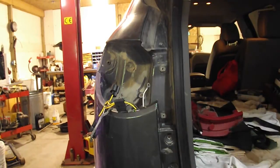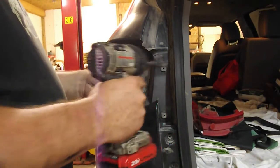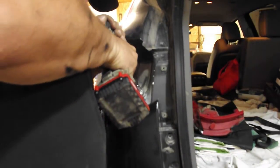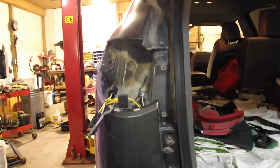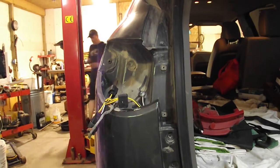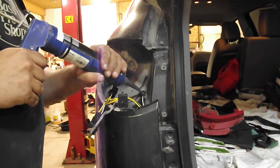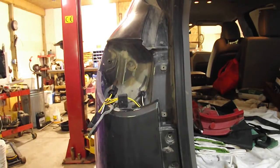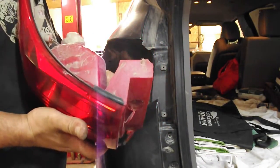To finish up this installation, we're going to create the ground. I ground off a little bit of paint earlier, so I've got a self-tapping screw and I'm going to run that in there and put some coating over the top of it. Then we'll go ahead and plug in our tail light and reinstall it. Always, always verify the proper operation of the tail lights after you've tampered with them and had them unplugged, because you don't want to send it down the road with lights that don't work. We're going to plug our tail light into the new harness.